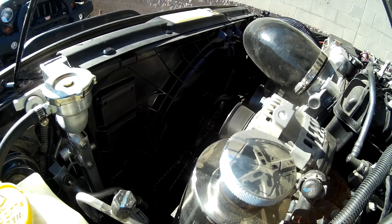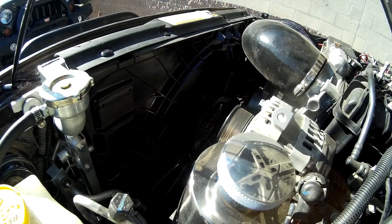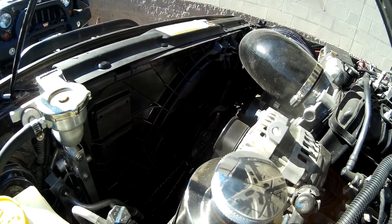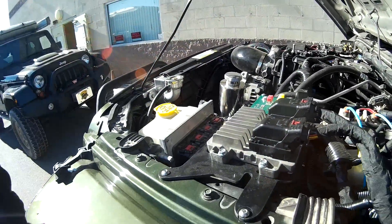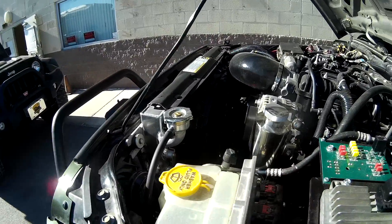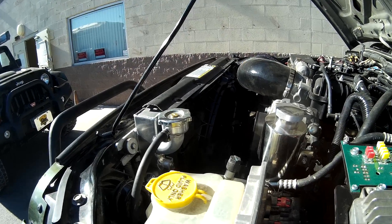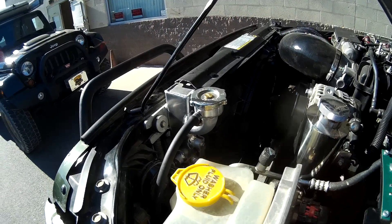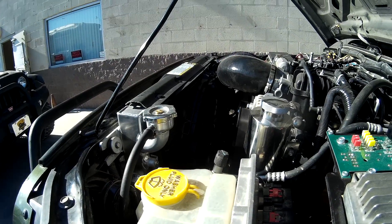That's 60% — it's really wound up, I can feel the air back here. So this is a little glimpse of the Camaro SS fan upgrade. You'll notice the coolant bottle is mounted remotely because there isn't a slot on the shroud as there would be if we had run a Pentastar fan. You'll also notice these little flapper doors on the Camaro, which the Pentastar fan does not have.